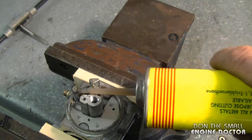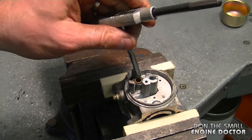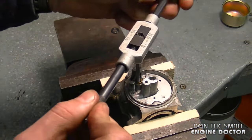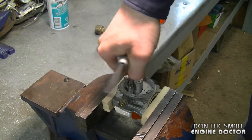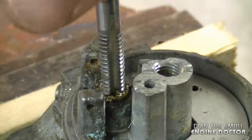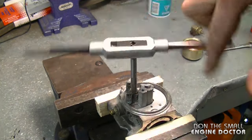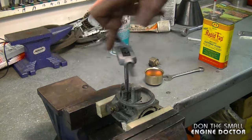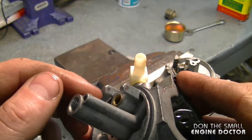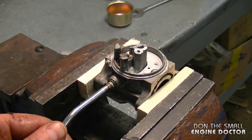What I do is use a quarter-inch tap. I put a bit of cutting oil on the seat itself — if you don't have cutting oil, any oil will work. You want to make some threads inside the seat; it's easy because it's only brass. Make sure you do it nice and straight. You don't have to go too deep — you'll feel some resistance quite soon. I go back down and back up just to make the threads nicer. Then blow some air through the connector to shoot out all the shards. Make sure to wear safety glasses when doing this.